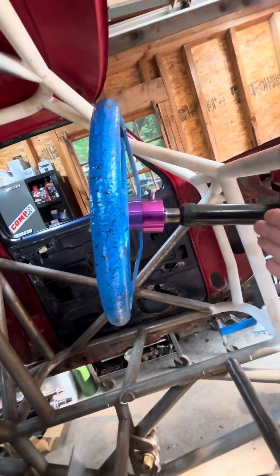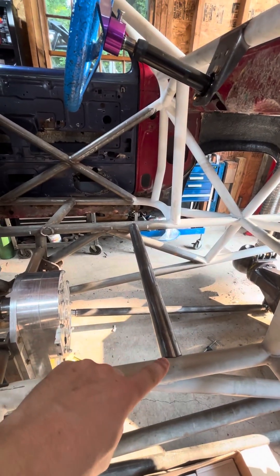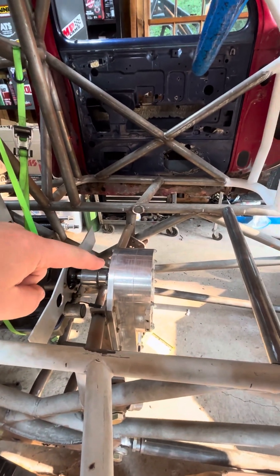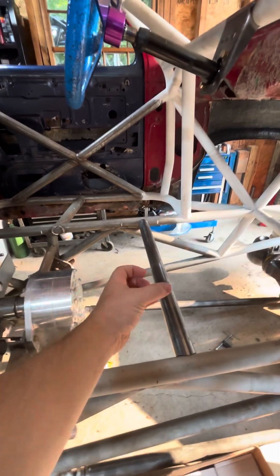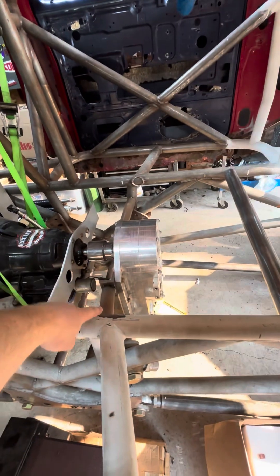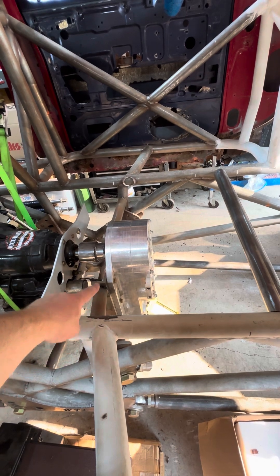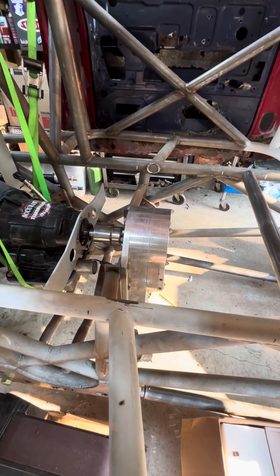I'm gonna move it down and make an extension that bolts to the steering wheel and the quick release, so when I get out I have an extra four to six inches of clearance. I took the crossmember out of here to fit the transfer case, so I'm putting one back in for the forward seat mounts so I have something to anchor off of. Then I'm figuring out the lengths and angles to get up and over and give me room between the transfer case — probably about an inch or so.